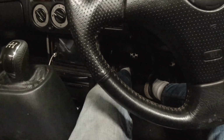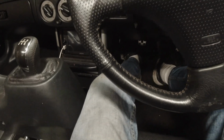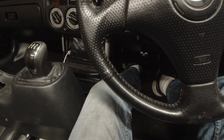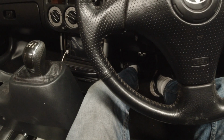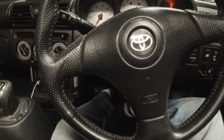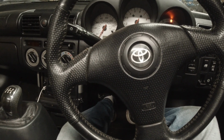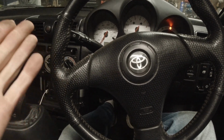Then go back to the brake pedal and pump it another 20, 30, 40 times. And if you're really, really lucky, you will hear the rear calipers, the ratchet mechanism setting, and you should hear a very distinctive click. That means that mechanism on that caliper has started to adjust up. It's the only way I've found to get the caliper to reset. Yes, it means sitting in the car with it running, pumping and pumping and pumping.